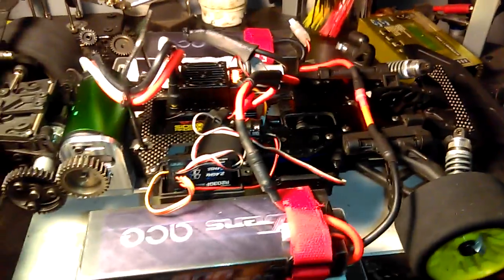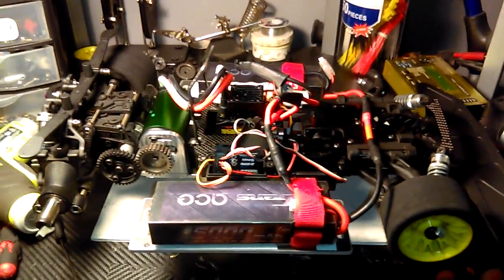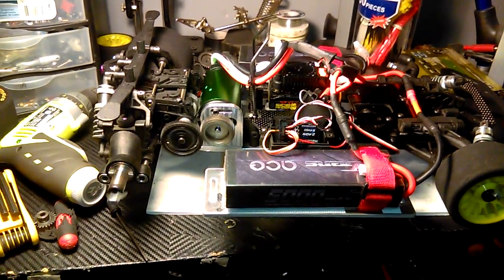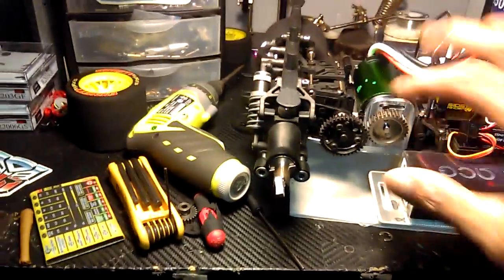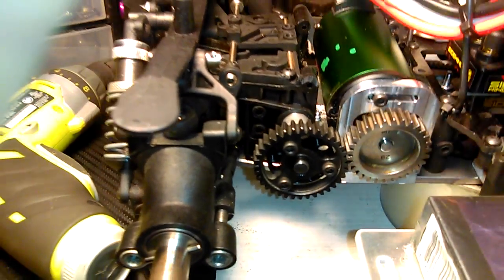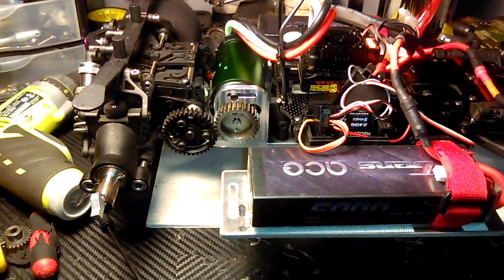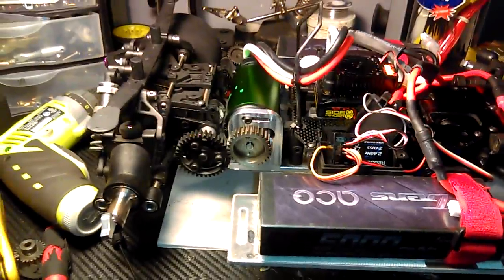Even though it's still kind of fast, I don't lose any power and I like that. That's the XR8 — in the other video I said XR3 like a dodo, this is the XR8. Almost done, no cogging, and that's just rear wheel drive right now — it's just a beast. My mesh sounds like it's a little too tight, just a little too tight. They're metal gears so they're going to make some kind of noise. The motor is brushless, and you're expected to cog just a little bit because of the four pole — the four magnets on the inside of the motor — but not like it was.